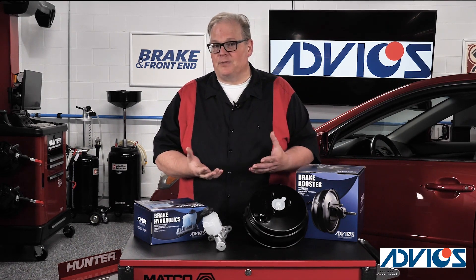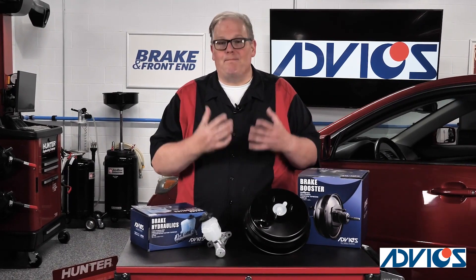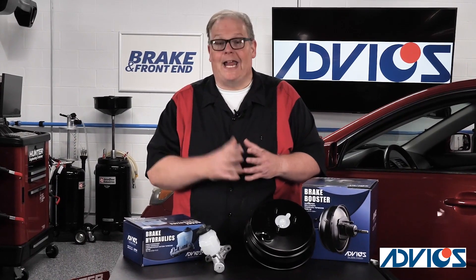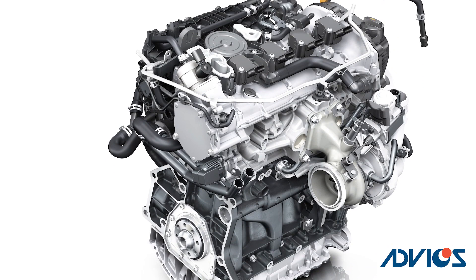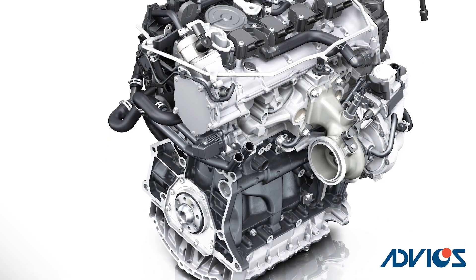You can find these types of pumps on Chrysler vehicles, Ford vehicles, VW vehicles — basically anytime you're dealing with a smaller engine that might have a turbocharger and direct injection. So it's critical that you solve that issue with the pump before you replace the brake booster or even a master cylinder. This way, you're going to come to the root cause of the problem and resolve it for the customer.